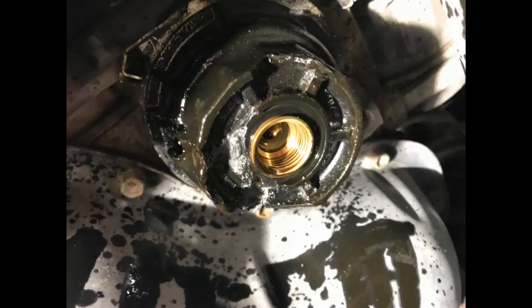Hey, what's going on everybody? This here is the oil filter cap for a 2013 Toyota Camry. Occasionally people find themselves in a bind with this one. The pins on the side will break off when you're trying to remove it if it's been over-tightened, or if someone forgets to undo the little metal tab up in the far right-hand corner of this photo. The person who tried to take this oil filter cap off did not know you have to bend that metal tab back to let it spin, and they broke the teeth off the cap, which caused the cap to leak. They couldn't get it off, so I've been sent in for the kill, and we're going to see how this goes.